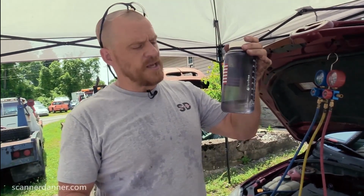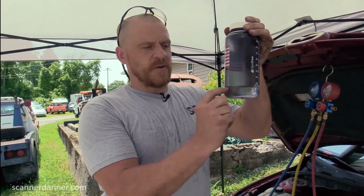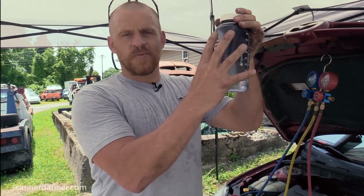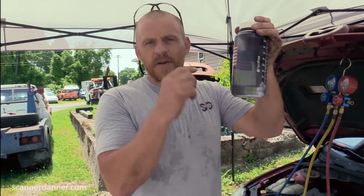What happens when we change the temperature and make it 100 degrees outside? What happens to this chamber? We boil more of the liquid. More of the liquid turns into a gas. We raise the pressure more, and now we have 100 psi in here, and we still have liquid left over.